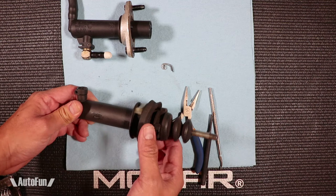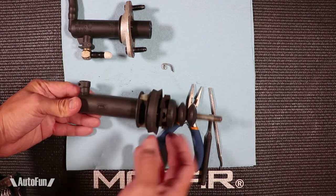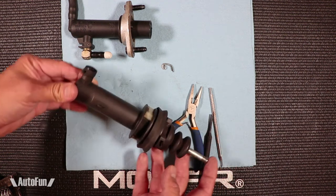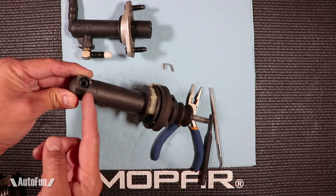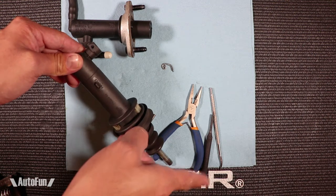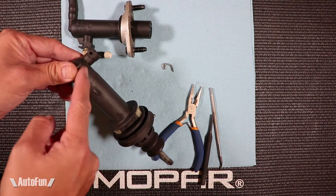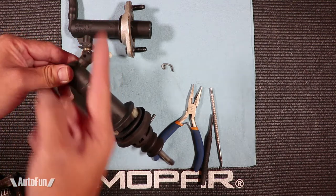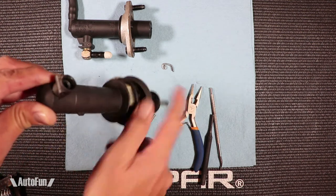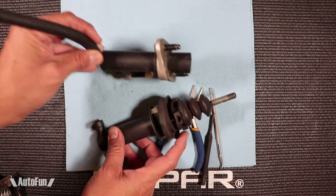Now here's the thing about hydraulics. If this is filled with fluid, there's a potential for bubbles. It is recommended that you tilt this — so if you were bleeding this, you want to tilt it so the highest point will be the exit. So if you were bleeding, the floor is down here, the exit is up — the bubbles will have a path to travel up. You want to have it hang down like this as it's being pushed so the air can flow out. Same thing with the lines — you want to hold the lines up.